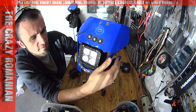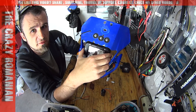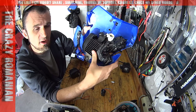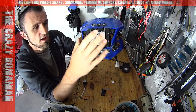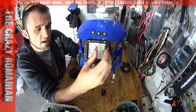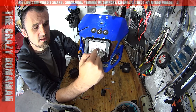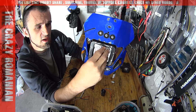This is my front mask from my WR 450F. The WR 450F has an AC stator and an AC light, so I had to modify it to run this LED light off the stator. This is not a Squadron — I didn't have $400 for a Squadron. This cost me only $50; I bought it from Amazon and I'll put a link in the video description. It's a 40-watt light and it's as powerful as a Squadron — definitely not street legal, but a powerful light for $40.